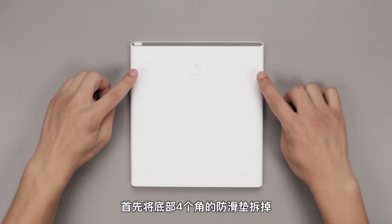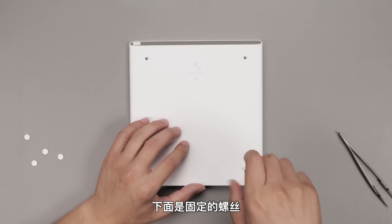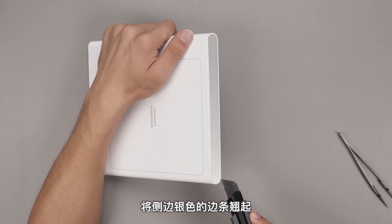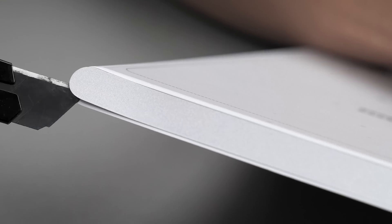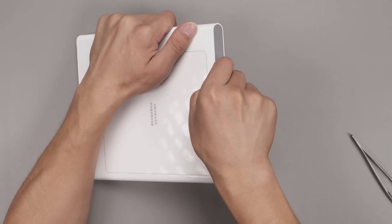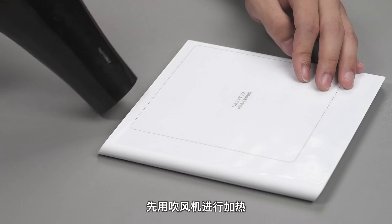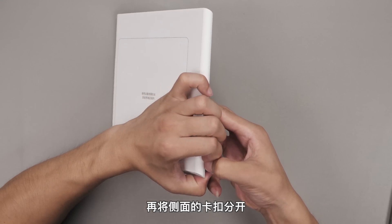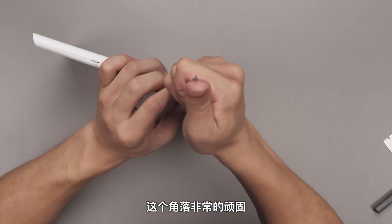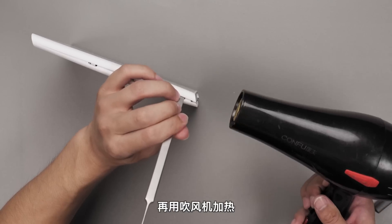Alright, one by one, we start with the Xiaomi one first. Remove the bottom anti-slip pad — screws are found below. Use a razor blade to pry up the silver side strip, then slowly cut through the adhesive underneath. Upon removal, we found that the two panels are fixed with adhesives. Use a hairdryer to heat it up, then separate the side buckles with tweezers, prying up along the edge. This corner is very tough — ended up using the hair dryer at nearly 100% force and finally did it.